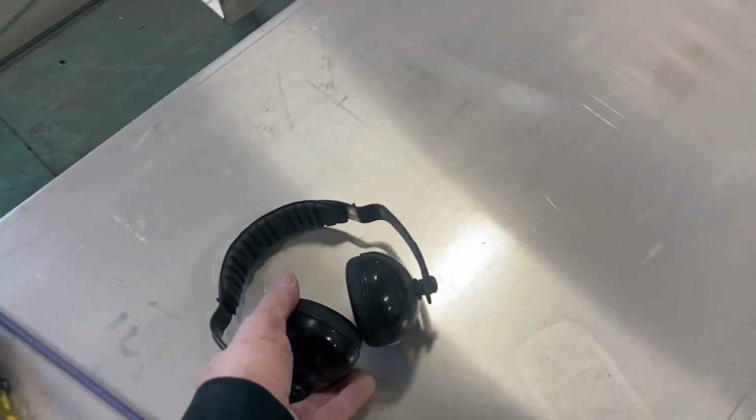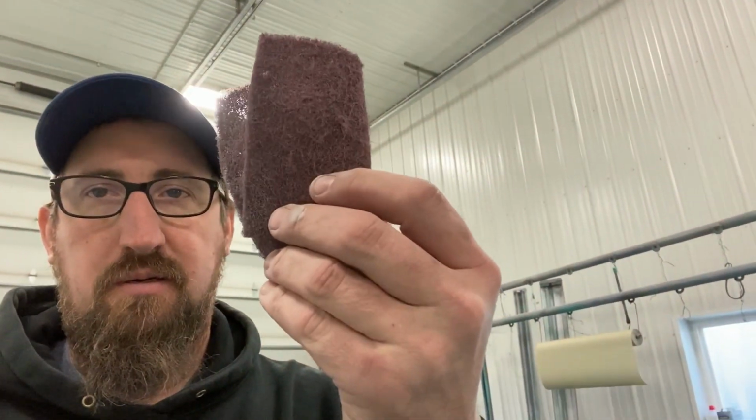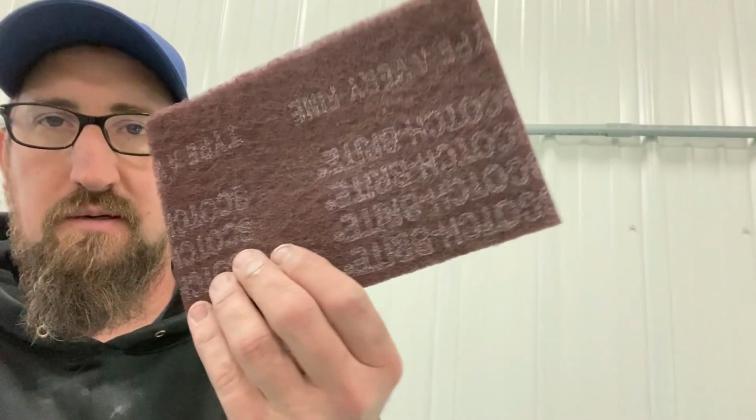You're gonna want one of these. Definitely gonna want a set of these. Now, like I said, if you're gonna spend the money on frame paint, please, please, please do that first. Run a Scotch-Brite pad, basically one of these. It's a little thin, she's used up, but I'll show you a new one, what they look like. One of these maroon pads. Just run one of them over the drive shaft, wipe it off first with some grease and wax remover, and then scuff it. Throw some etch primer on it before you put your color on.